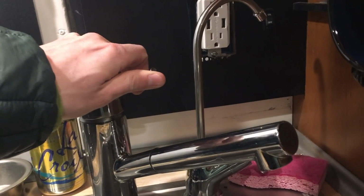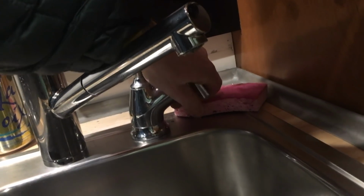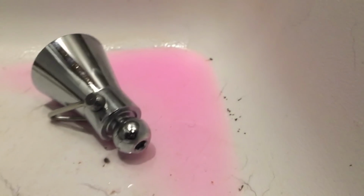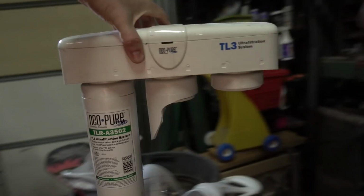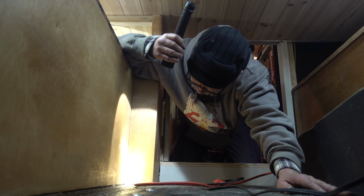so that the water had a place to go rather than forcing itself out, because what had happened was the water forced its way through my valves and blew those valves out. It broke right through the copper elbow. It popped my shower head off, so that ball joint just poof, and then a big icicle was poking out. All the PEX was fine. All that stuff survived.